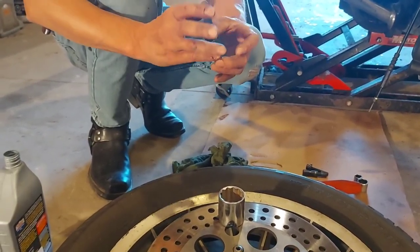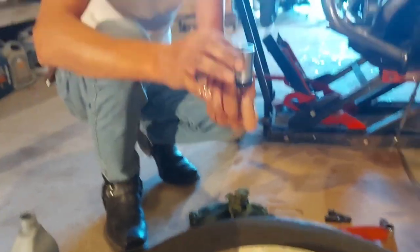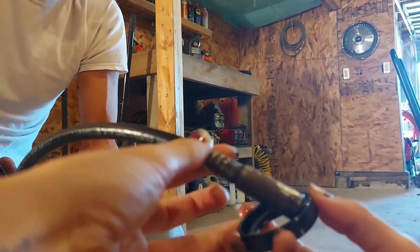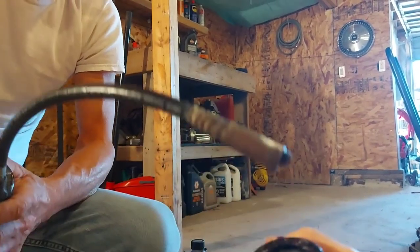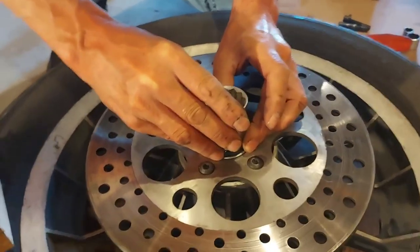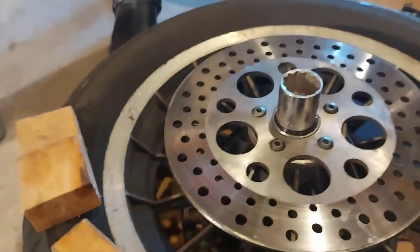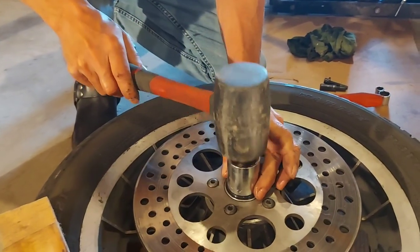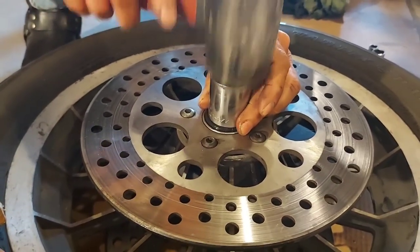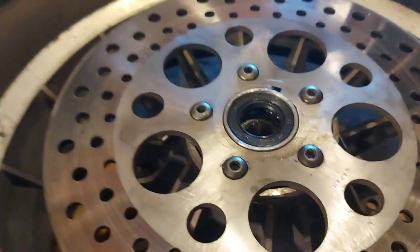Using our high-tech piece of wood and our trusty 18 millimeter, we're just going to remove that seal — just like that, and she comes right out of there. There's the old one and here's our new one. That didn't seem to be doing too bad — it's actually not in that bad of shape, the edge is going a little bit. These bearings are actually really good too; I think they've already been changed. Stick your finger in there and you can see it's well packed with grease, it's clean, and it wasn't loose. I might just tell Carl to save his money and keep them in there. Ahead and install our new seal — put a little oil on that, and a little grease on the inside before we put it in. What you want to do is take a socket the same size as the seal and just drop it in there and give it a gentle tap with a rubber hammer. That's it — right around the edge. Center it, put your socket on it, make sure you're straight up and down, push it right in there. Give that a little tap — you want it just past flush, just recessed a little bit. Just like that, that's fine.